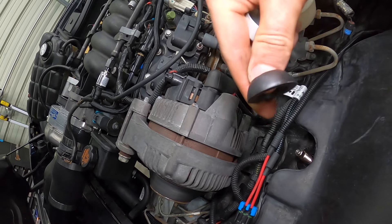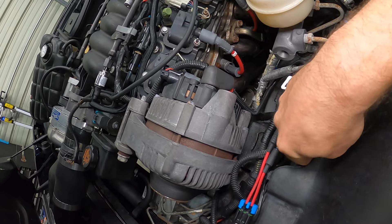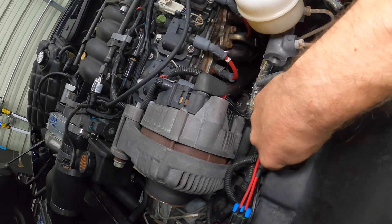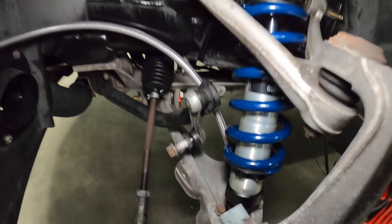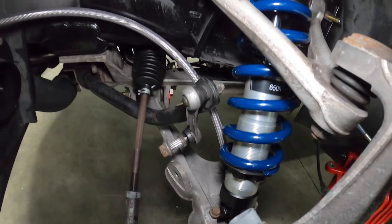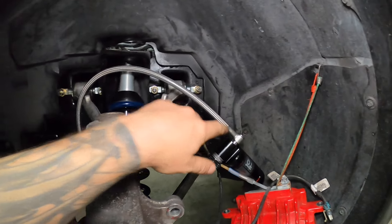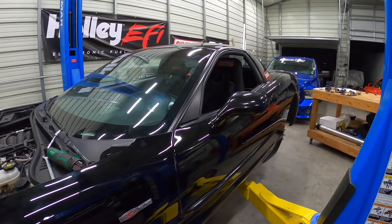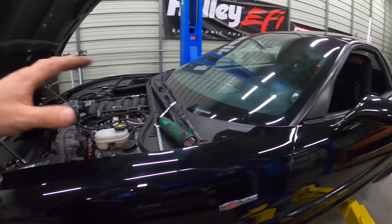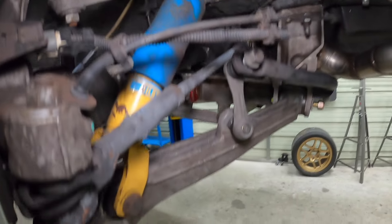Take the collar and put the portion that contacts the spring facing up. Roll it down towards the bottom so we can get the spring on here. Take our plastic washer and pop that on there. At this point, you can remove the little plastic nub in the collar from shipping. Place your spring on top, another plastic washer, the cup, and then take the C-clip with your hands and place it over the top. Slide it down until it snaps in place and we're installed. Bring the collar up — we'll adjust everything later, but this holds everything in place.